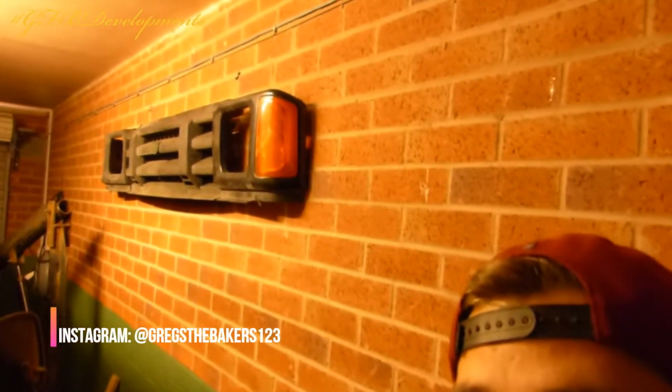Here in my garage. So I've just put the grill up on the wall for the old Discovery. Here with me today, I'm about to change the studs on the manifold and the inlet, because when you do a 200 TDI conversion to route the exhaust easier, you put a 300 TDI turbo on. And one of the things you have to do is change the studs, because the studs are shorter on a 200, which means the manifold's thicker on the 300. So I've ordered the studs, they're here.